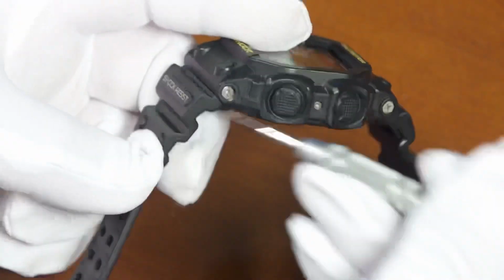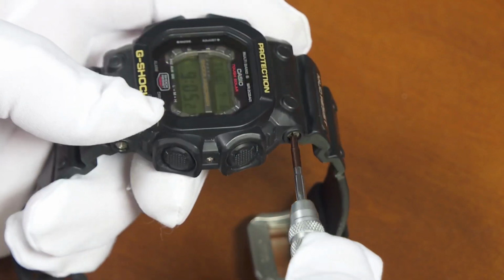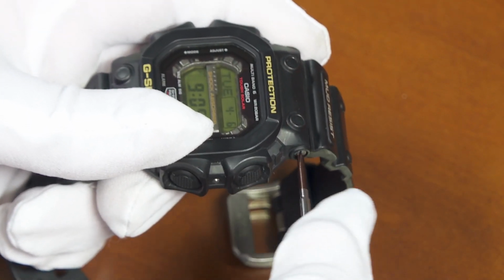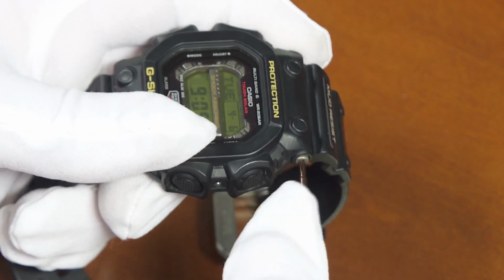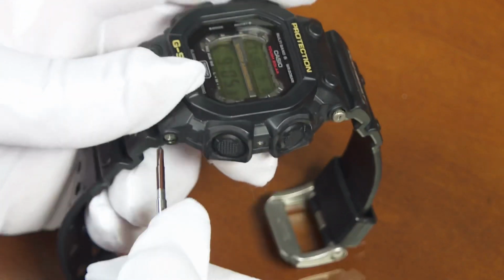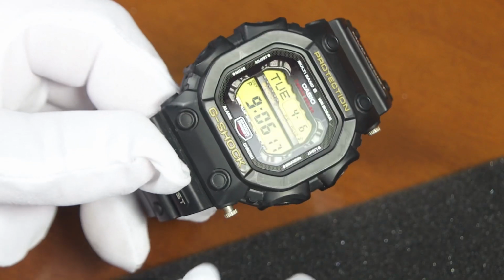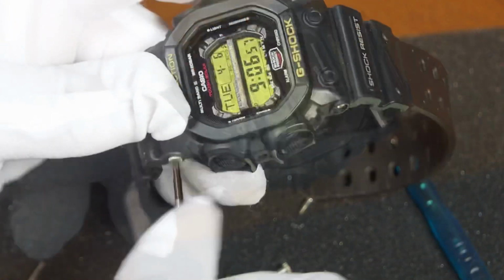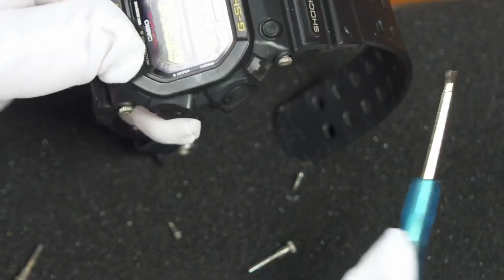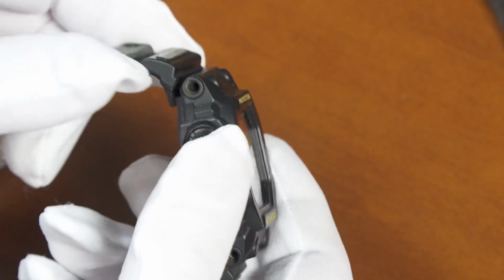The small one in the middle comes out pretty easily and just falls out. The ones on the ends that are holding the watch band in, you can loosen them up, but they don't just fall out all by themselves. You gotta kind of coax them out a little bit. So I just used the one screwdriver to make sure I pulled them the rest of the way out. So you take off the 3 screws on the one side, and then, of course, you remove the 3 screws on the other side. And that actually will release not only the bezel, but it will release the watch band from the watch as well. So you can just pull the pieces of the watch band out very easily.